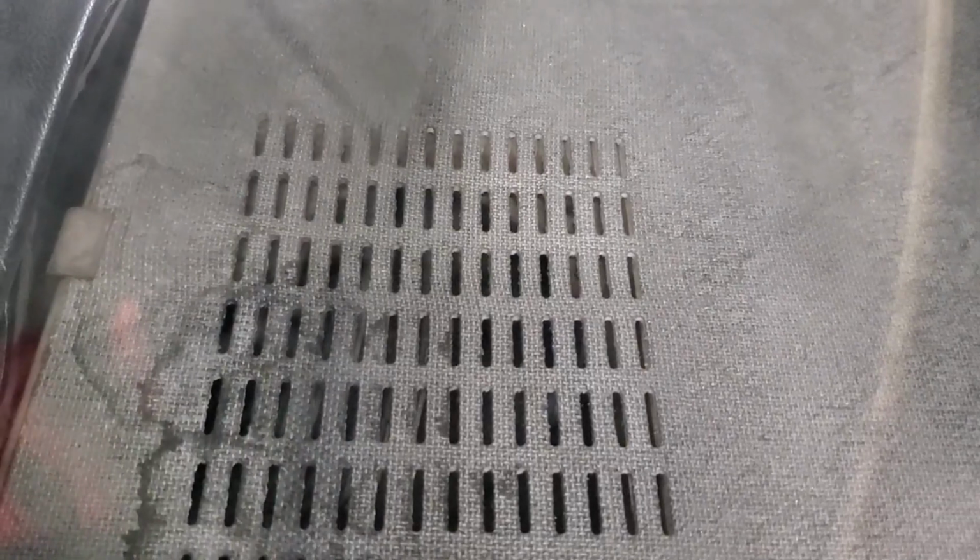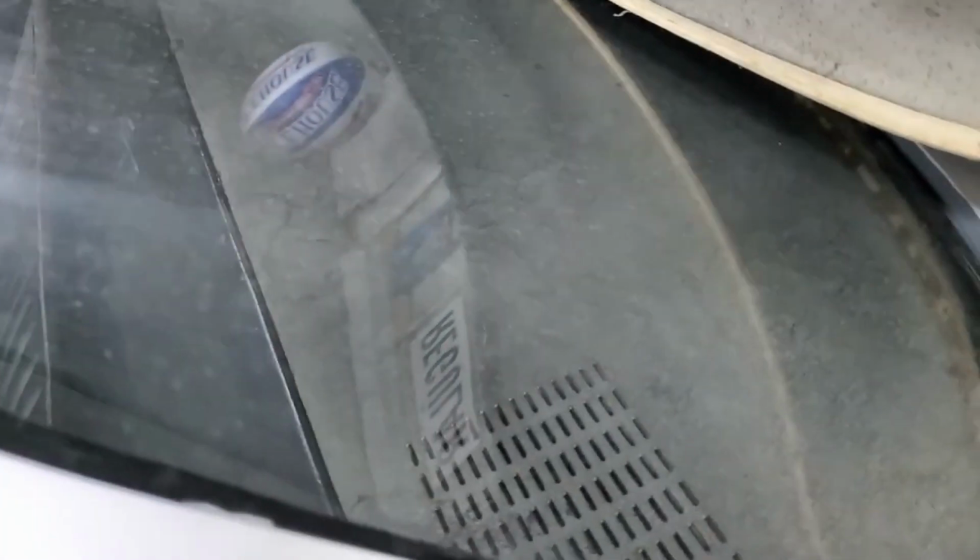We also talked about this package tray. It's hard to say. This is that stuff that's in a lot of old 60s and 70s cars. It's like a pressed cardboard, textured crap. Because I think the day it rolled off the factory, as soon as it got dirty, this is what you were stuck with. You can't clean that stuff. It's just nasty. So I suggested we pull that out and I put a layer of fiberglass over the whole thing and smooth it. Paint it body color. I think it would look really good. I don't know if it should be gloss or semi-gloss back there, but got to get rid of that because it just looks horrible. I mean, the water stains and spots, and it's the first thing you see when you walk up to the back of this car, and that needs to go.